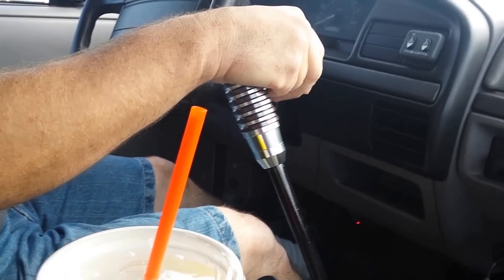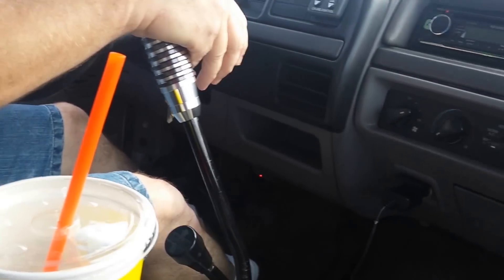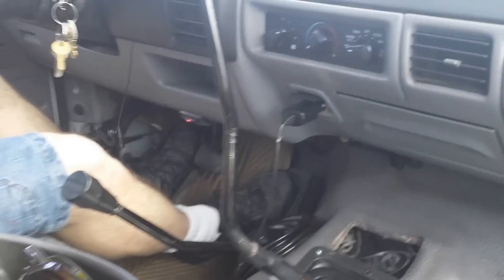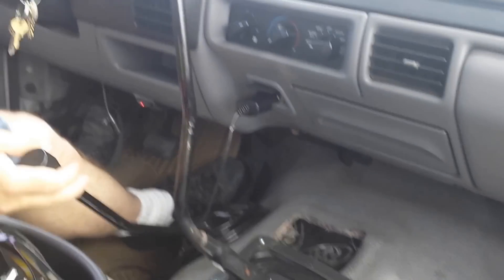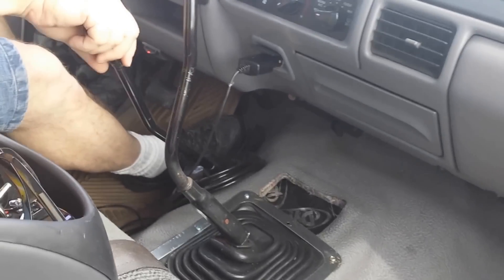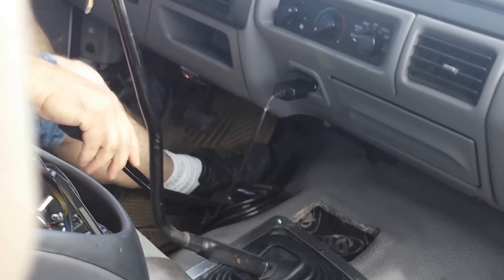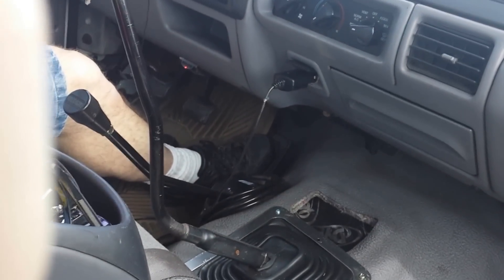And I will demonstrate how I drive it like a five-speed as soon as traffic clears. Start in second direct, then I'm going to shift to third direct, just like normal. Then we'll split third. I'll rush the shift a little bit — that's why I grind it.